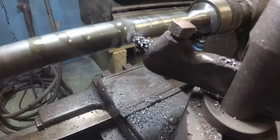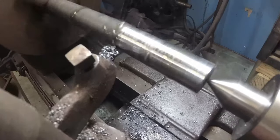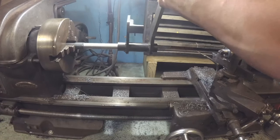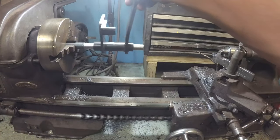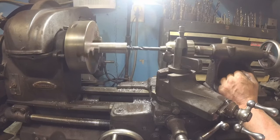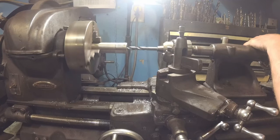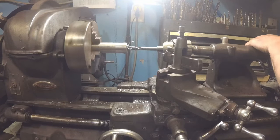I needed to disassemble the pedal assembly so I could fabricate a rod that runs from the factory brake pedal over to where the new location is going to be. I decided to make it so it slid inside the pipe they used factory to make the brake pedal pivot on. Then I machined a piece that slid over that same rod on the opposite side, which I'm going to weld the lever onto that actuates the master cylinder.